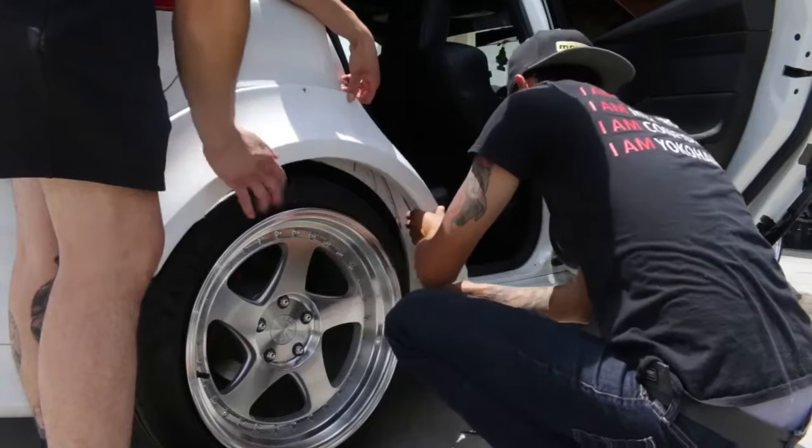And bolt in your fender flare to its entirety so it gets the most flex that it can after you've cut it, so that you know how much you need to add and how much you need to cut off. Because we made that mistake last time where we left only a few bolts in there and it didn't push it all the way against the panel. And then at that point, it created a bigger gap than what we needed, so.